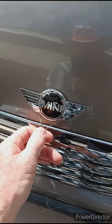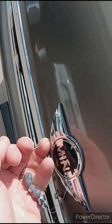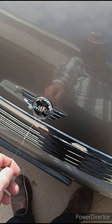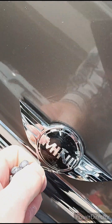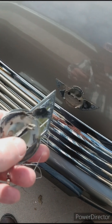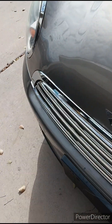I've got the nylon leader under here — I don't think it's gonna crack. You can see I can pull on that and look at it move. Using two hands, I'm pretty sure I can rip that off. I attached the fishing line leader and just tightened it up — look at that, getting it pulling off. I can get my fingers underneath now — oh yeah! Working the fishing line leader because it's nylon, no scratches. I'll get some Goo Gone and clean that up.